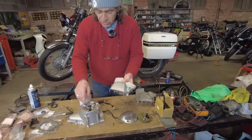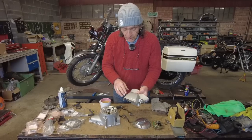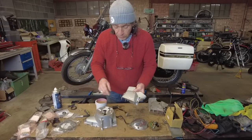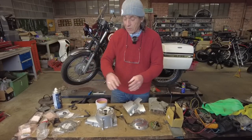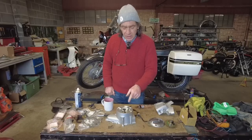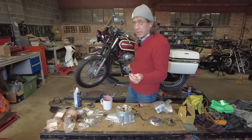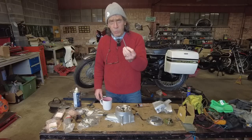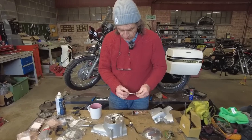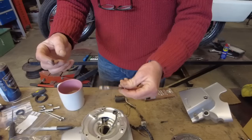You may also notice this had crosshead screws for some reason. The clutch cover also has crossheads; the other side has allen bolts. I thought I'd upgrade it, so I've just been down the fastening place in Bedford and bought some stainless allen bolts to fix them on with - just so it'll be matching on both sides. Now, because these are stainless and they're going mostly into aluminium, you must copper slip these bolts or they will seize. In years to come when you go to get them out it'll be a nightmare. Just get a dab on your fingers, spin it, get it on the threads and on the shaft as well, because they can seize in the actual casing.